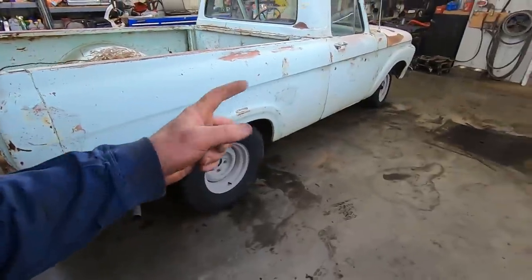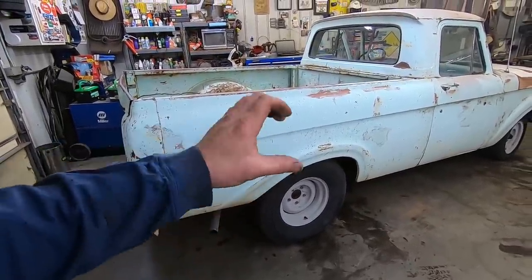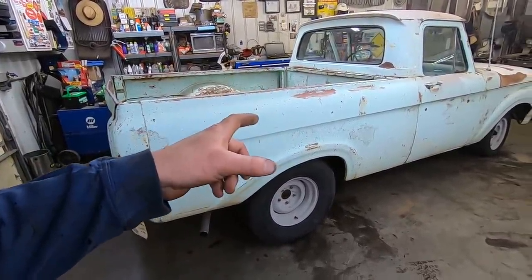It sits way too high. It's got a straight axle on the front and then a 9-inch in the rear. The 9-inch is super sloppy. It needs a different 9-inch. The thing about the 3-speed in this thing, I think it's got like 3.70 gears in the rear because it's humming down the road pretty good, even with those tall tires. But like first gear, you can do like 30 miles an hour, but it's just super hard on the clutch taking off. And I think that's why this clutch was smoked when I got it. And it looked like the clutch had been smoked before that. It needs a different transmission. I'm thinking an overdrive would be good. Really, to be honest, it needs a V8 and an overdrive and everything else.